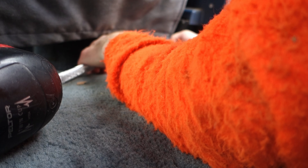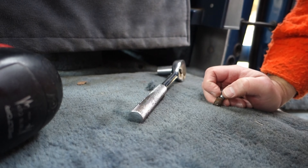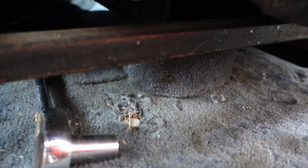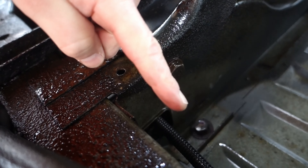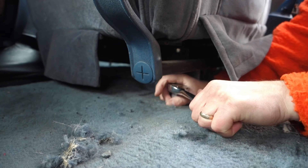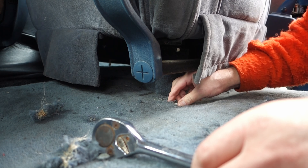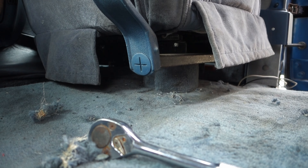There we go — that's what we want to hear. Happy, happy — the sound of vice grips falling. All right, last bolt on this seat. Got the carpet cut away again; it's a 5/8 bolt. I went underneath and cut the stud off, then got the vice grips on there. The sound of falling vice grips makes me so happy. And there we go — the last stud — so that should mean this seat is completely free.